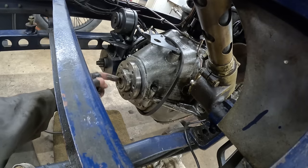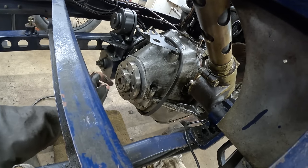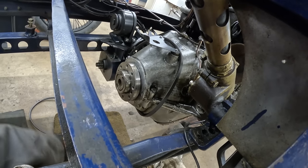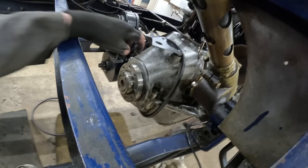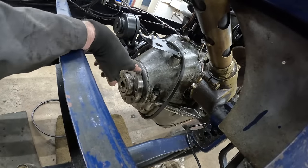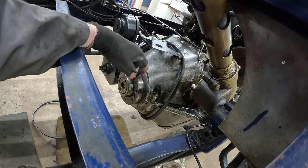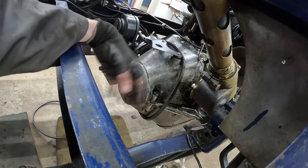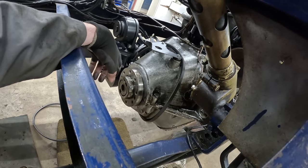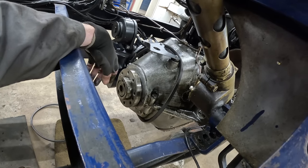And then of course we had to put a hole in the end of the crankshaft for the first motion shaft. So we had to put the crank up in a big lathe and machine that out. But anyway, that turned out to be a fantastic success. And then the oil seal that's normally on the outside of there, we plugged the ends of the bolts, and then this thing's got a scroll on it, so that as it's turning, it's pushing the oil back. And we thought it might not leak, but we were fantastically lucky because it don't leak at all. So it's really, really good.